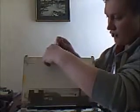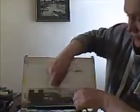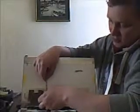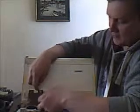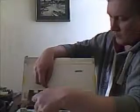Okay. So what we're going to do is unpick the cable for the webcam. Unpick the cable from underneath here. Bit of tape that sticks this on here. Get that off. Don't pull it too hard because you'll expose the wires. Loosen this bit off here. And now that there's nothing sticky, it should just pull out. There we go. Done. Like I say, this screen just is in the frame.